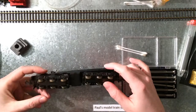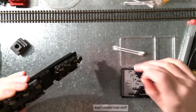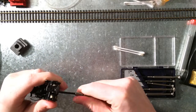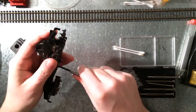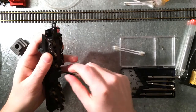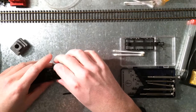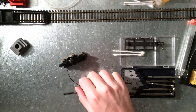And then we're good to go. So again with these old Limas I usually start by taking off this bottom side here. That should free the whole motor block. There we go — that's one, keeping them apart of course. I don't want to lose any screws, and although you rarely see me lose screws in the videos, I do lose screws a lot. There should actually be a few on the floor right now. So taking that one off, and then I can just lift the engine out like that. Also unclip this. There we go. Put that aside, don't want to have that damaged.